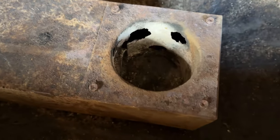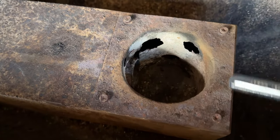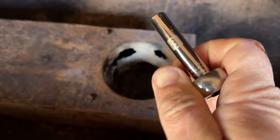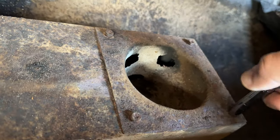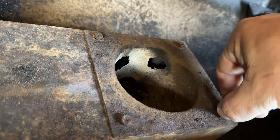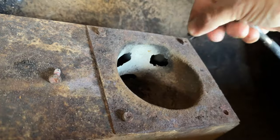All we have to do is remove these four screws. What we're going to use is a number eight socket to remove these. You can look and see if you can use the Phillips head on this, but this is so old, rusted, and heat driven that you're probably going to need to just use the socket.